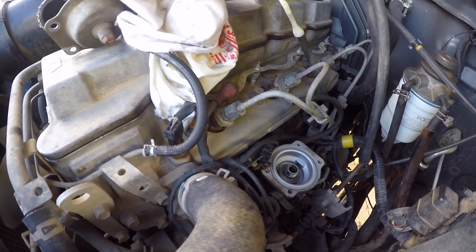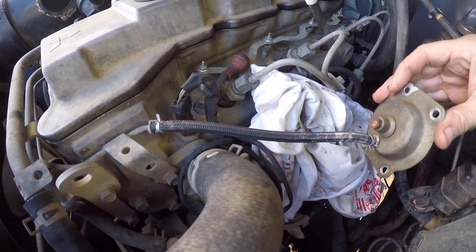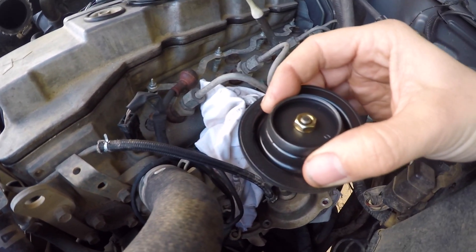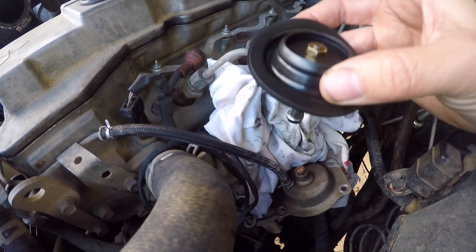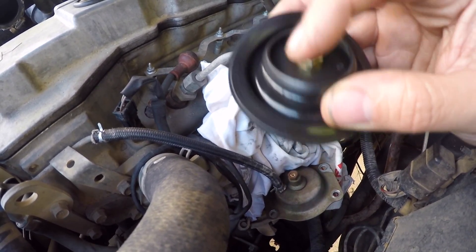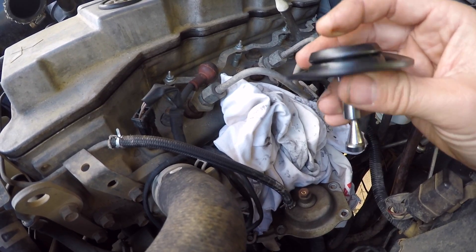There are a couple of adjustments I'm not going to mess with. I only suggest you mess with these if you've got access to a dyno and you're doing a proper tune on the car. Basically you've got this screw here which adjusts the depth of this pin. What that does is when the diaphragm is seated it determines the height. So that screw determines the height of the pin — that's all preset at the factory. It is adjustable depending on how far you're going with the tuning, but on this DIY home tune I'm not going to mess with that.